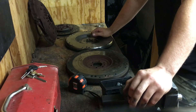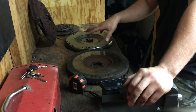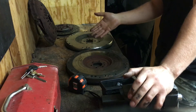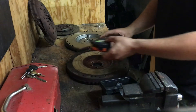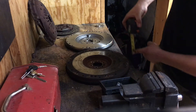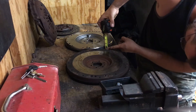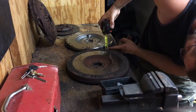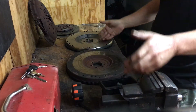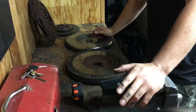That's not true — the diameters are similar. The only differences I've seen, besides talking about two different generations of engines with different architecture, is the thickness. This flywheel is one and a half inches. The LS is one and 3/8ths. Most folks who have any education between the two engines know that.